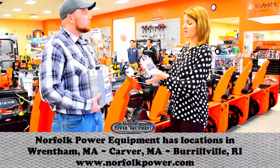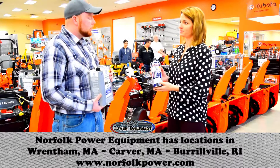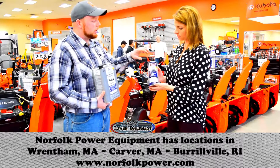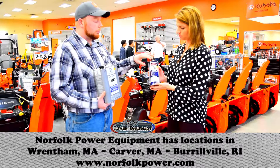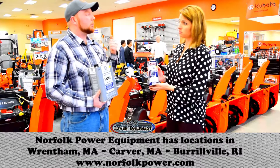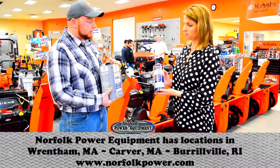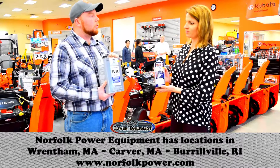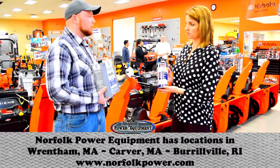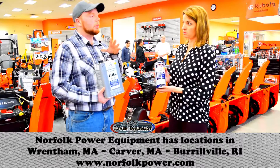So, this big can of flammable liquid that you just gave me — what do we need to know about that? You need to know there are a couple of different varieties out there. In this case, this is blended at a 50 to 1 mixture, to be utilized in smaller equipment like string trimmers and backpack blowers. What I have here is the exact same thing, except there's no oil in it — this is going to be used in your bigger equipment, your lawn mowers and snow blowers. This is really what you want to make sure you put in the machine at the end of the season.